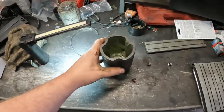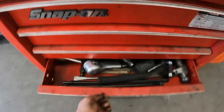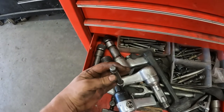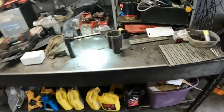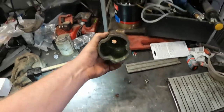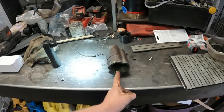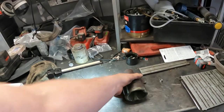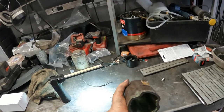All I do is get a big air hammer — one of these 498s — and put a flat punch bit on there. I put the air hammer in there so it's kind of pointing into the vehicle. With one hand on the air hammer, I put it right against there and hit that until it goes all the way through. Then it starts tapping on the stub shaft behind, and at the same time I grab this with my other hand and I'm pulling. You don't even need to pull that hard — just put steady pressure. And this sucker, no matter how rusty it is, it'll pop off.